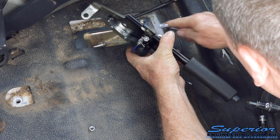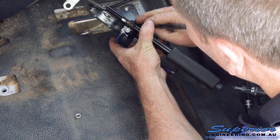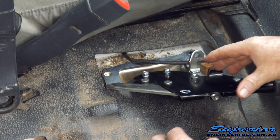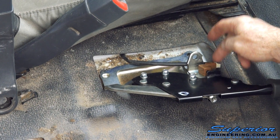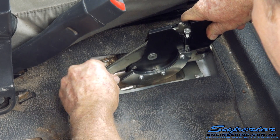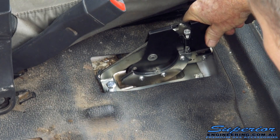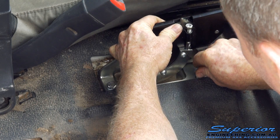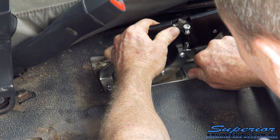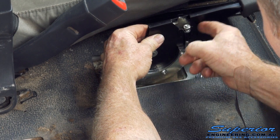Now that's all in place. Once you've got the handbrake all nice and tight, put your handbrake wiring in. Then the supplied bolts in the kit — you can start assembling the handbrake back to factory how it was, like with the four bolts in place. Then from that point on we can adjust the handbrake, and we'll wind this down to the right spot.